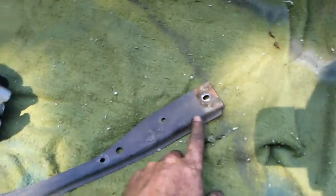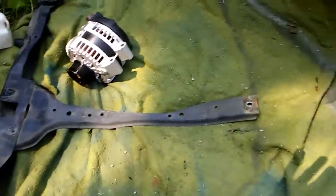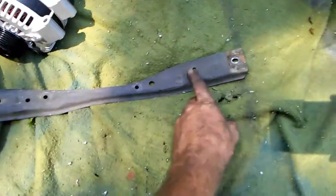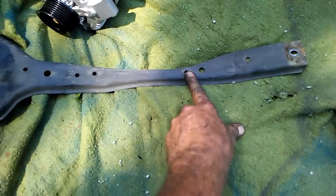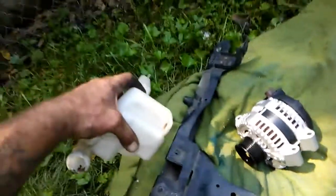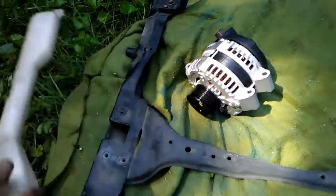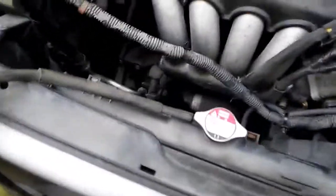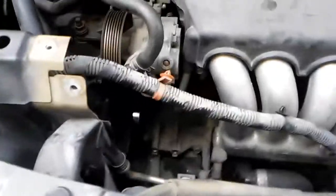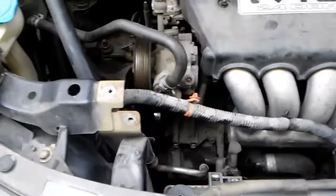The hardest part for me was a crusty bolt at the bottom of your radiator support, or core support — your upper support. That bolt, plus a wiring tab holder there and another holder, and then your overflow tank which is one bolt and stabs in on the bottom. After you get that headache out of the way, it was actually extremely simple — so simple that it's annoying how long it took to get everything undone.